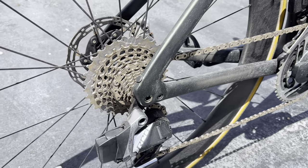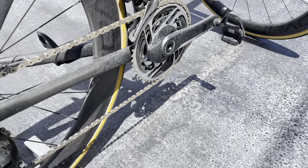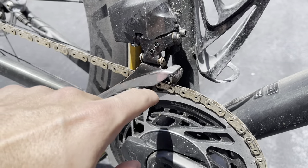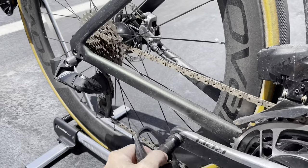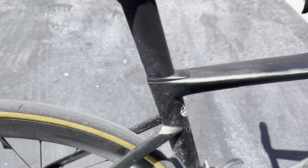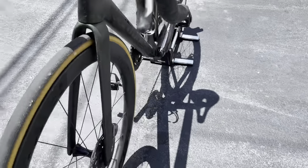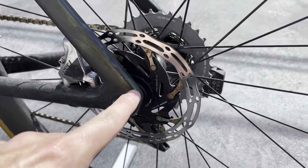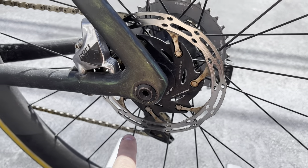There's like no lube on here — it's just metal on metal, a lot of resistance. The springs on the derailleurs right here, you can see they're starting to corrode, get a little rust on there. You can hear it when you're pedaling — it sounds like a birdcage, squeak squeak squeak. You can also see the tires getting gashed up, a bunch of water and moisture marks on the front fork, corrosion on the front. Look at the rotors in the back — you have rust on the flat mount disc brakes, points of corrosion where the water just sits on top.